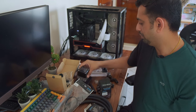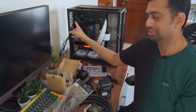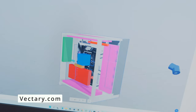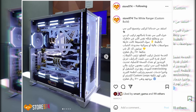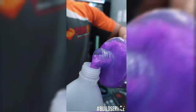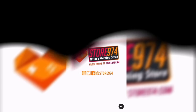That's all the components. The CPU pump block will go up here while the reservoir will be mounted on the back side of the Lian Li O11 case — there's a section back there where nothing else goes, and I've measured everything out. For those building their first loop, a simple planning method is to get a model of your case and plan the loop using a tool like Vectr or any free online software that lets you load a CAD image. If you're in Qatar and don't want the hassle, check out the custom water-cooled builds at Store 974 — link in the description.